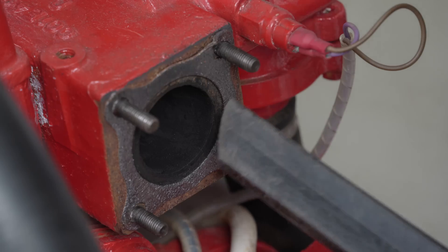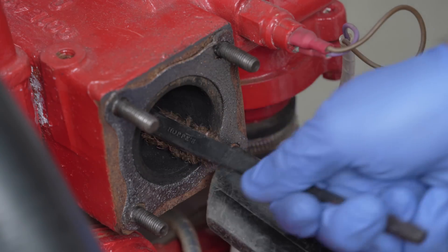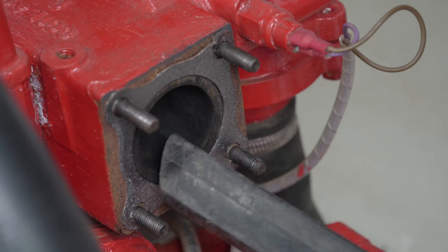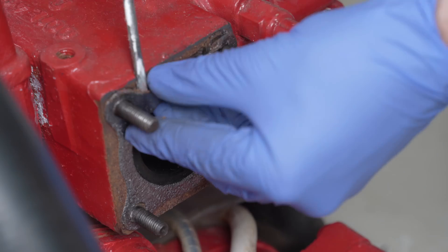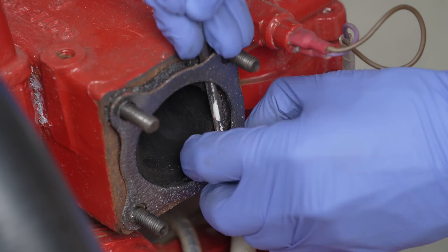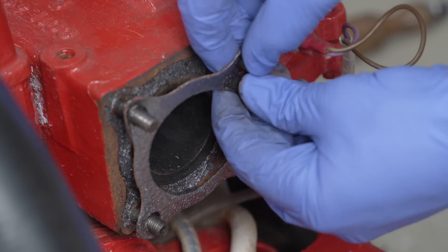An interim job I needed to do was, using a copper brush, cleaning out the engine's exhaust outlet. There was some soot inside I loosened and then hoovered up, and then the old gasket needed to come off. It's the sort that, with extreme heat from the exhaust gases, bonds to the steel and forms an excellent seal — they're very much single use gaskets.